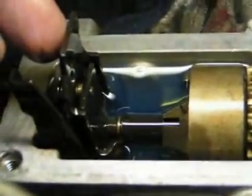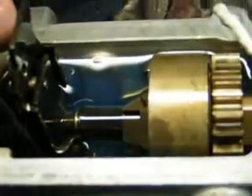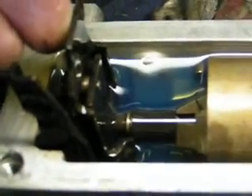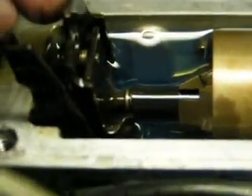So what we've got to do is, if you want to lift your RPM, regardless of what the counterweights are doing, you can either remove the counterweights or do the other mod where you can actually compress the shim in the spring. There's a way around it — if you have a look here, you can see underneath the cover.